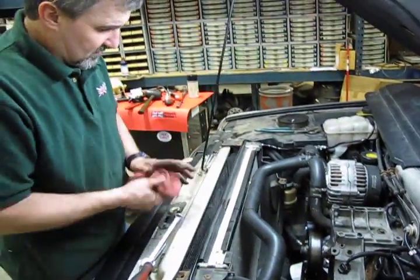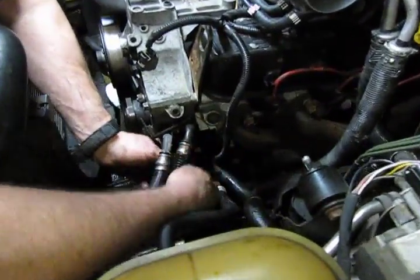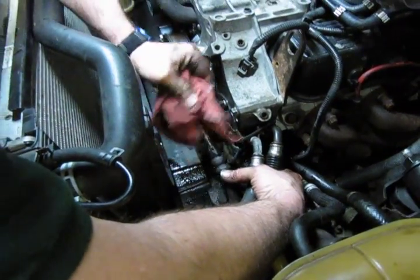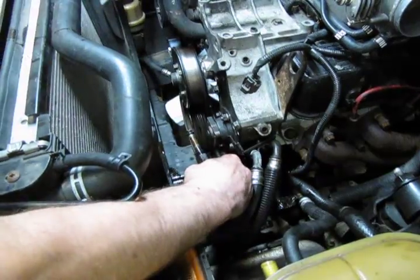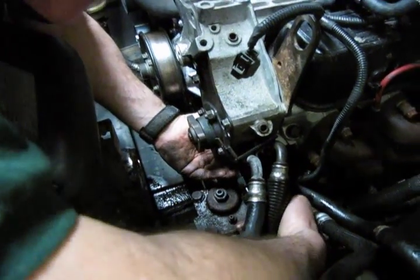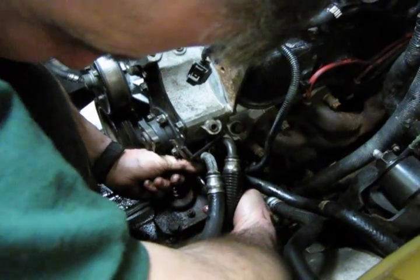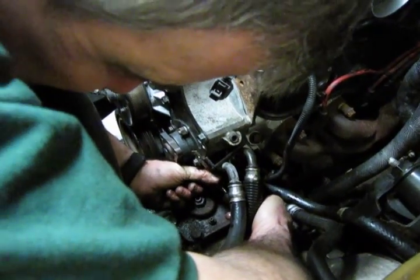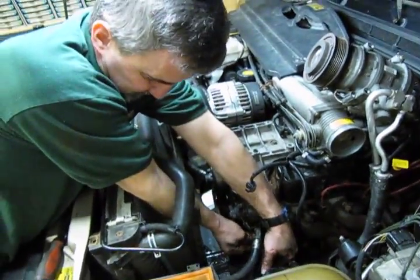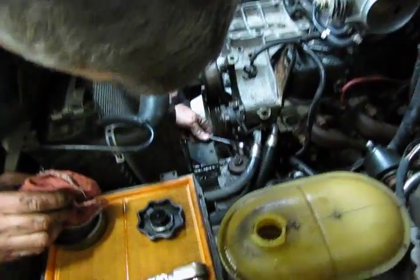now back in place. So next what you're going to do is put your pressure line back on. Again, we've checked the O-ring. And I want to just give it a quick wipe, make sure we have no dirt or any buildup on the end there. You'll actually feel this insert right in the opening. Run the nut forward. You may need to just wiggle it around a little bit just to get the nut to start, so you'll feel it. And then we'll just tighten up with a wrench.